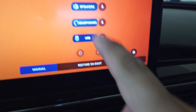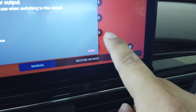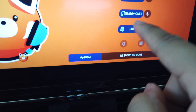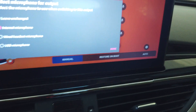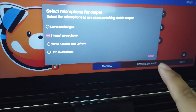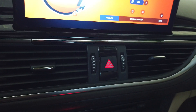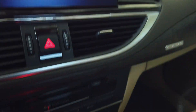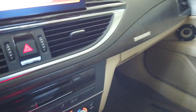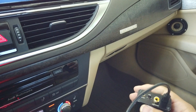Now there's a solution — an app called USB Audio Switch, a paid app from the Play Store. It shows a USB indicator and mic icons, so whenever a USB sound device is connected, you can continuously select which mic the system uses. Choose the internal microphone, and the mic will remain active for voice commands while all sound output goes through the USB DAC and digital coaxial output to your high-end DSP.